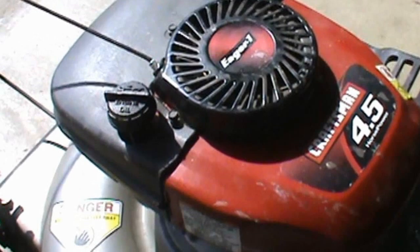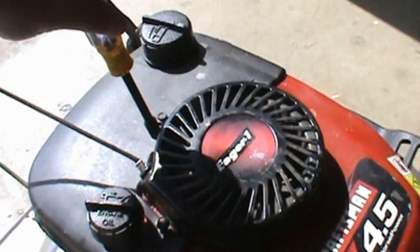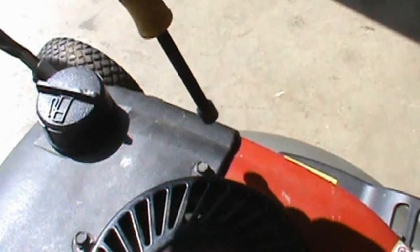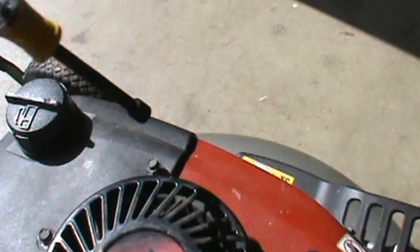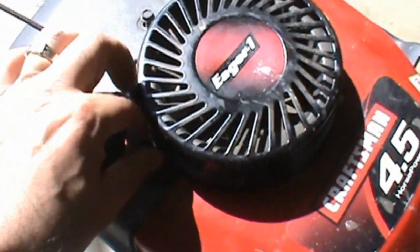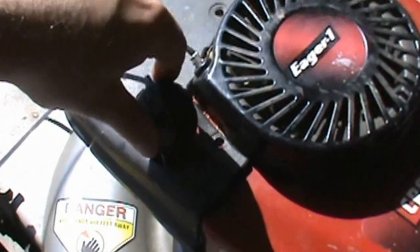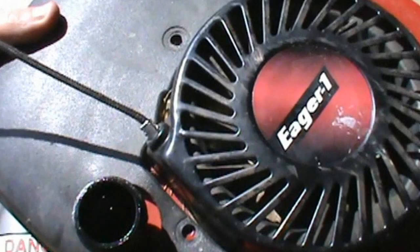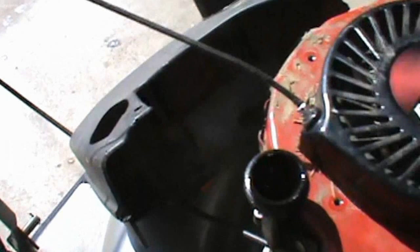To replace our coil, we need to loosen up these 5/16-inch screws and remove the gas tank from the mower — that'll be the first thing to take off. There are three bolts right here. I already have them pretty much loose, so now I'm going to pull the bolts out. I'm also going to remove our oil dipstick just to get that out of the way. I put a towel here to keep it from dripping, then pick up the tank — it usually just locks in and lifts straight up.